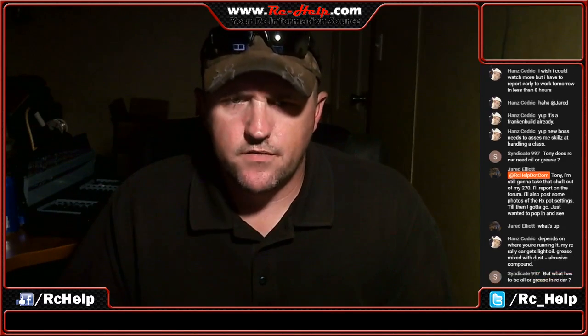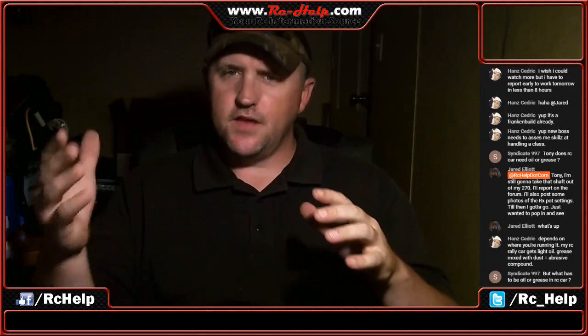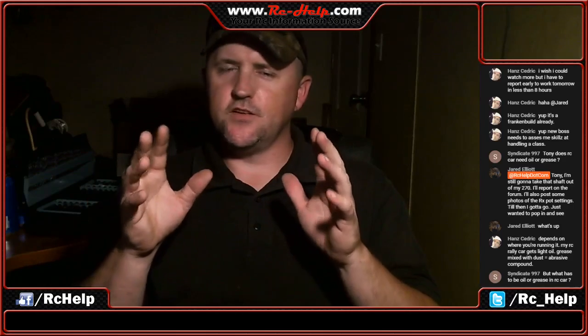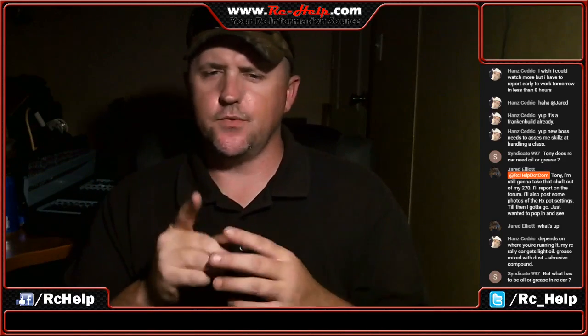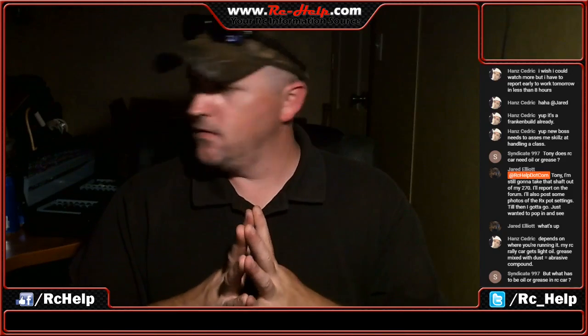I'm still going to take that shaft out of my 270. I'll report. Okay, yeah. Because just the way, you know, the tail is vibrating, the elevator is vibrating, the aileron's not so much, but there's something. It's either bent or the blades are out of balance or something. Check your feathering shaft too. But check all your shafts, check your blades.